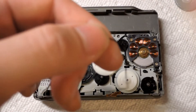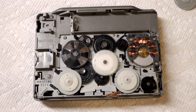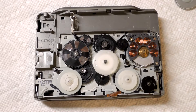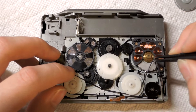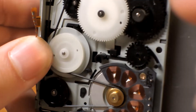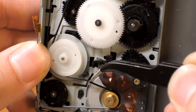You see that motor — it's a little flimsy. I removed it and right now I'm just running my finger through it to feel if it's sticky or not. In my case, it's not sticky at all, it's really smooth. So that means the pulleys are probably clean. Take your new belt and route it in place — this part is kind of tricky. On the board, underneath the board, there's a little picture to tell you how the belt is supposed to be routed.